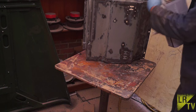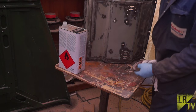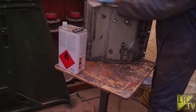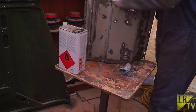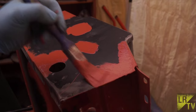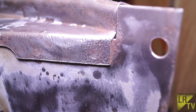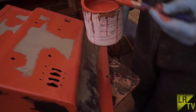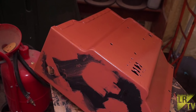I've done a thorough job here because I want to paint this quite nicely. For the last step before putting the primer on, I'm just getting rid of the rest of the under-seal and all the dust using a panel wipe — that will ensure the primer will stick properly. Basically we're covering any metal that's had rust on it. Once we put this on and let it dry, we'll key it back down, then undercoat it and topcoat it with paint.